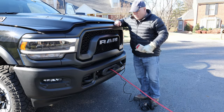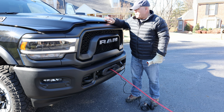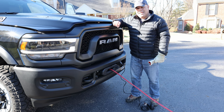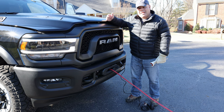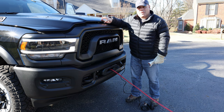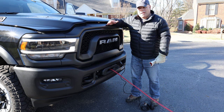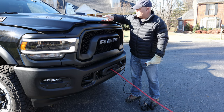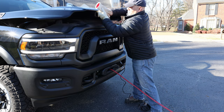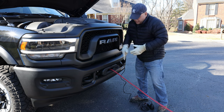One last thing to keep in mind: when you are winching, you do want to open up your hood. The reason is that if that cable breaks, you don't want it to come through your windshield. You want it to hit the inside of your hood — that protects the rest of your truck. You do some damage, but I'd much rather have a little bit of body damage, because most of this stuff is steel, especially the bumper, than have it go through my windshield. So let's open that up and then we can start the process of pulling things in.